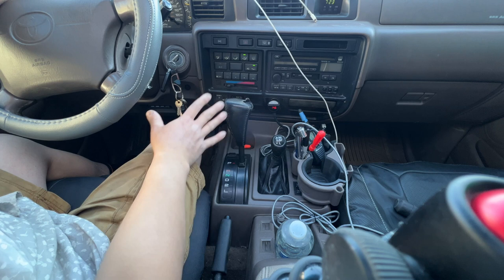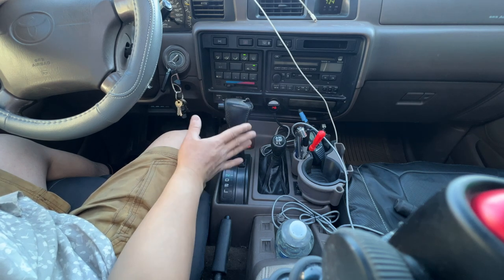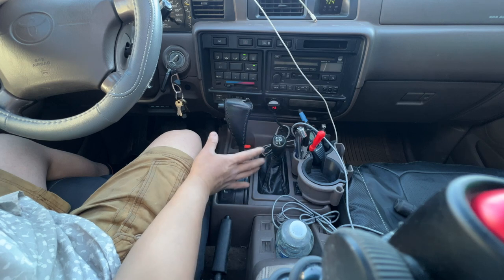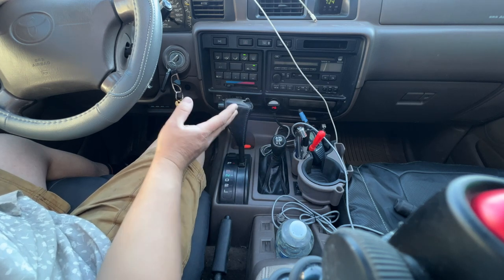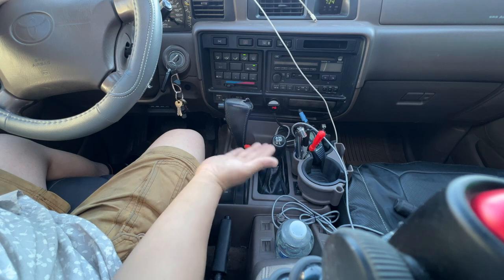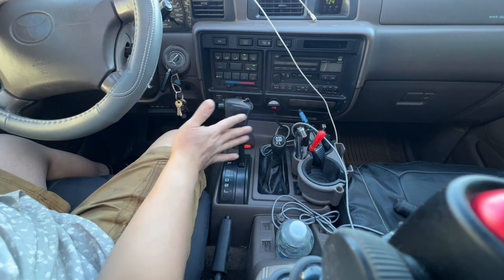When you're off-roading, I recommend you use your center diff lock — lock it up so both your front and rear driveline have equal power going to them. The center diff lock is not the same as your front and rear locker. Your front and rear locker is a whole different ball game. You either have the triple lock or you have to install an aftermarket locker. I will not talk about the front and rear lockers because that doesn't apply here.